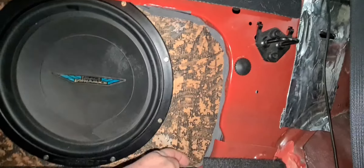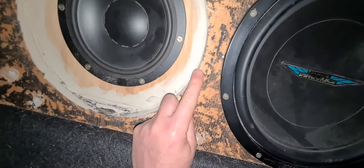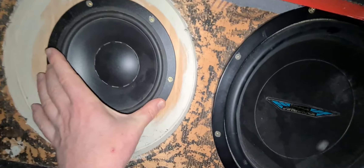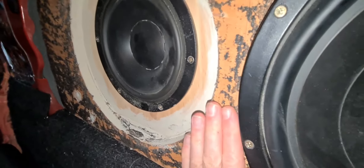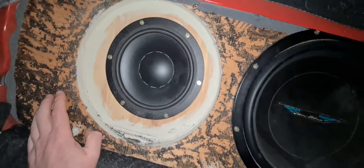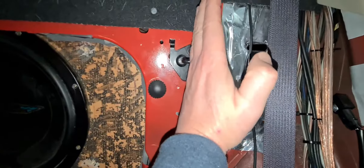I'm going to put a piece of black carpet anywhere you see wood — maybe an extra couple of centimeters behind that line — and underneath the diameter of this woofer. I'm going to try a trick: make a piece of carpet all the way across that spot, then push the woofer into it to cut the carpet hole, and screw the woofer in. The cover will stretch across the shape giving me almost like a satellite dish curve, without having to do any bogging or filling — just a nice little carpet ramp.